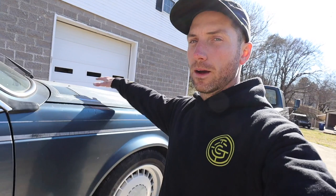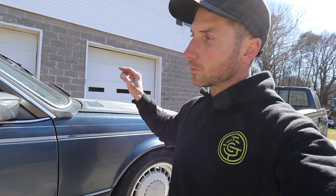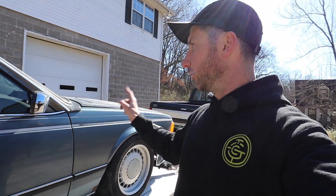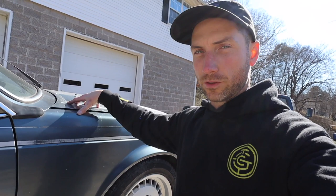The wild card on this motor, or on this car, is that it's got a Motronic injection on it, and that's not the injection that the early M90s had on it. So Sutton kind of threw that flag up. But upon reading a little bit further into the internet, I found that guys with 81 635 CSI cars from Europe do have an M90 with Motronic from the factory. So it sounds like 81 may be an only year M90 with Motronic in a Euro 635.